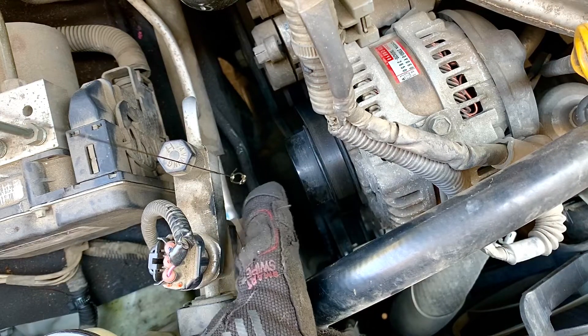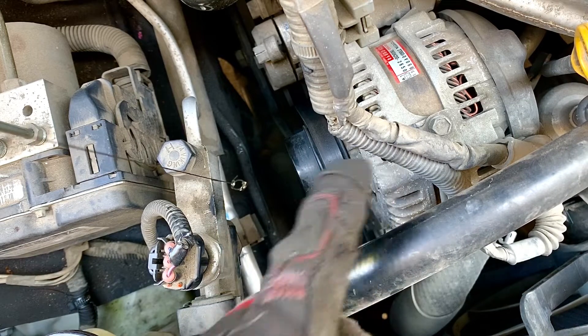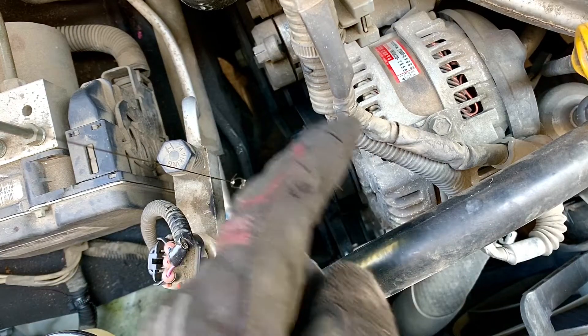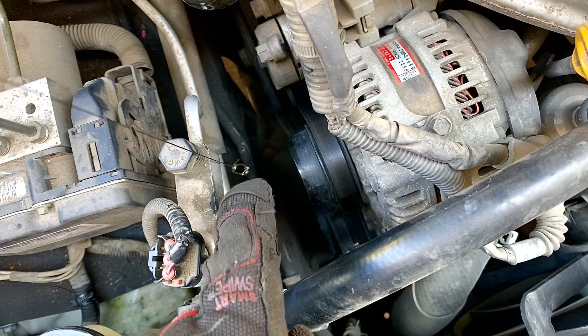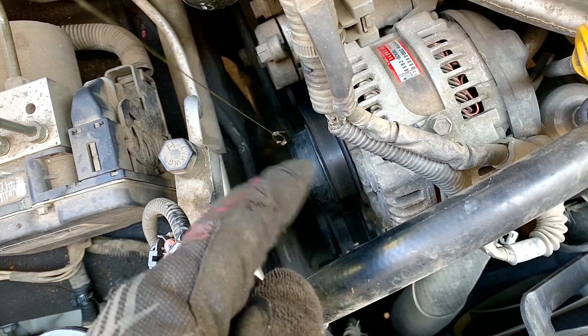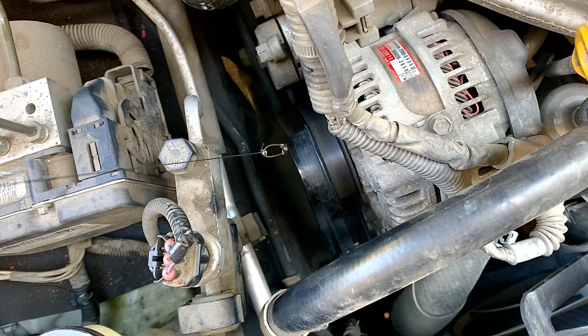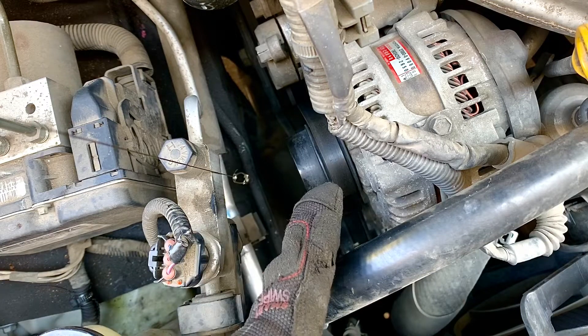That's how you tell — it's a quick test to see if your alternator is creating the magnetic field it needs to create a charge. As you saw, the pin was brought over to the alternator pulley and there's still some magnetic field even after I turned off the key. That magnetic field is still there but it's weak and it's being created by the alternator. So if the alternator wasn't doing its job, this will be one simple test that you can do.